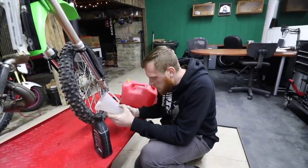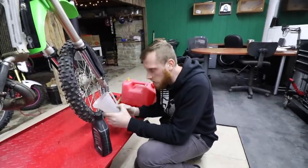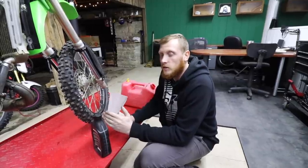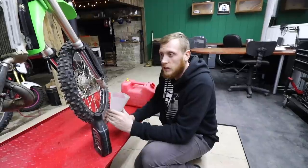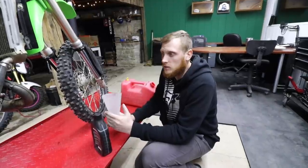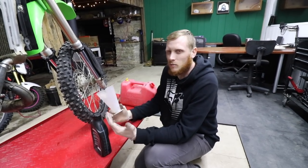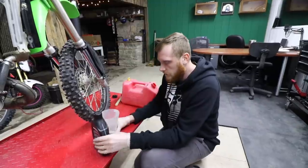But I hear a lot of myths of people who run more oil, say like 28 or 24, and that essentially what that's gonna do is make you run lean because the oil is too thick to flow through the jets. So if it's not jetted properly, you're actually gonna be running lean, which is not good, obviously. It's the complete opposite of what you're trying to do, so it just doesn't work that way. So I think we're gonna do 32:1 for the break-in.